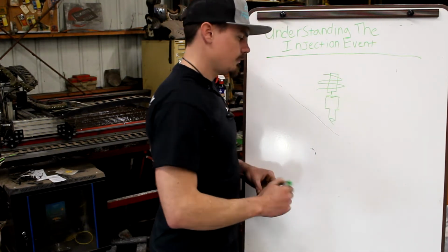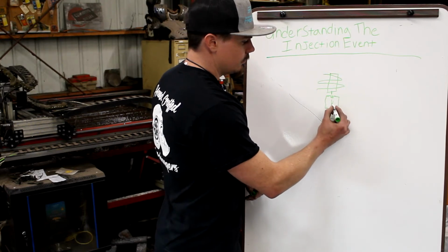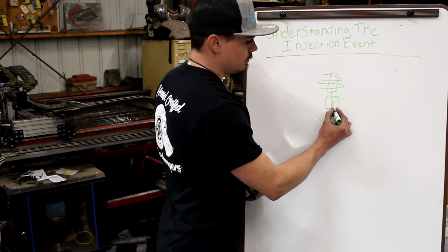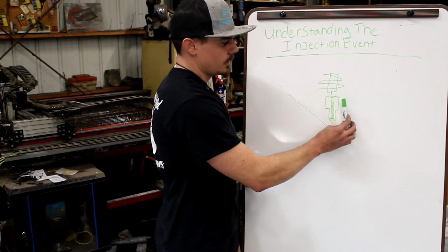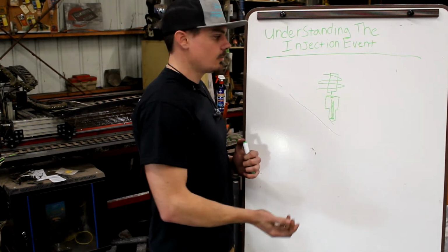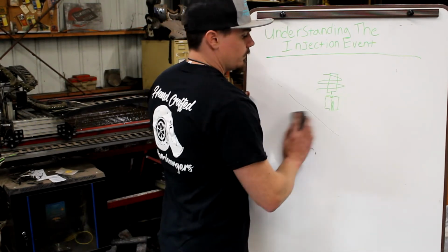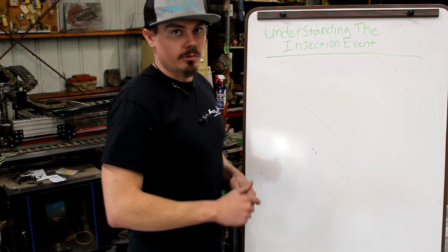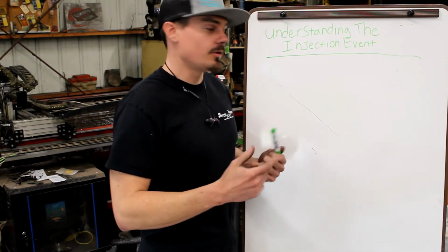Just as the button, it's actually like a lift valve. This is connected to the seat, called a pintle. What they do is when you energize the coil, it's going to pick the seat up, and when we de-energize the coil, it's going to put the pintle back down. Now, we might think that it's instantaneous. To the human brain, it is instantaneous. I don't think there's any possible way for us to see it without a really fast camera.